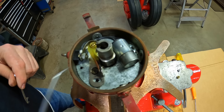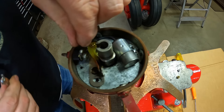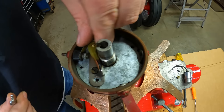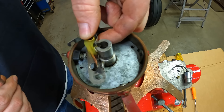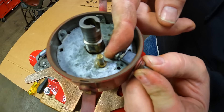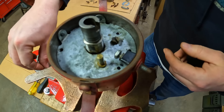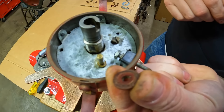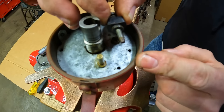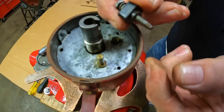All of the electrical leads are secured beneath the nut on that small stud. So we'll back that off, pull the condenser lug out, and the points plate should come out - comes off that peg right there. Next we need to remove this contact lead from the housing. This is a similar setup to the terminals that passed through the generator housing - just a steel stud that has an insulating washer on the outside. This insulating block that it passes through keeps it from shorting out against the housing itself. The little stud comes out - you can see the square end on there keeps it from turning.